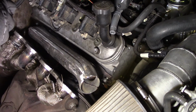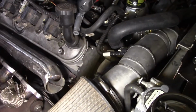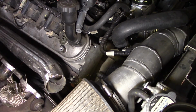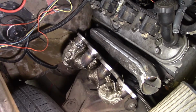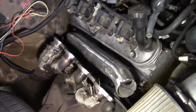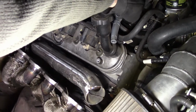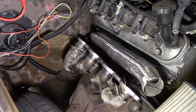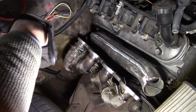I've got dash 8, so I'll have to come in and put a dash 8 right there on my fuel. That fuel line right there is dash 6 on the crossover, but all of this back here, all of that is dash 8 already. And that guy right there is dash 6 right by the brake cleaner. I'll have to come back to dash 8. But I've got 8 all the way forward to back, so I've got all of it set up. I'll have to get some bigger injectors.